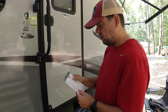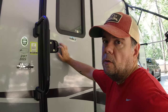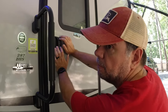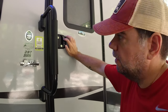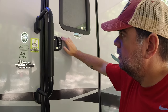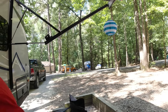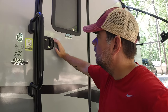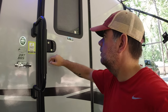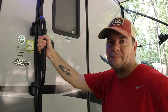So, you hit the 8th button and then the lock button and let go. The long beep lets you know you're in programming mode. Hold down 8th, let go. Now we enter the default code, hit the lock button, and then enter whatever our new code is going to be — look away! Hit the lock button, and then hit it one more time. And that should be our new code. All done.